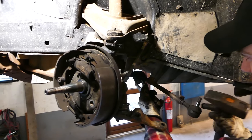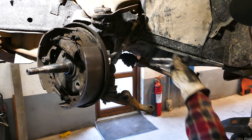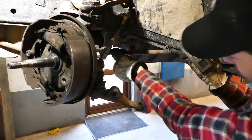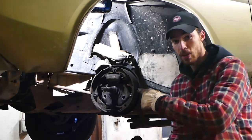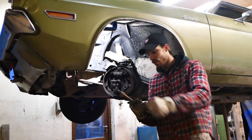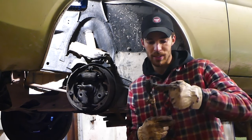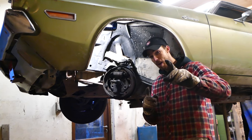Then we just got to get the tie rods off. Of course, in this completely survivor Challenger, you've got rubber pads, plastic inner fenders around the brake lines and the steering stuff, so there's not as much room to work. One victory on the ball joint turned into another defeat on the tie rod - this end was absolutely seized into the drag link or center link, and it's completely pitted around the concave area where it seats into the arm. Mopar no kind! Please kill me.